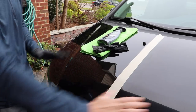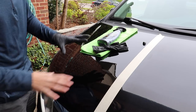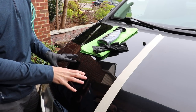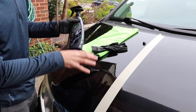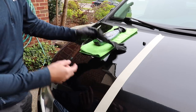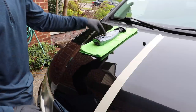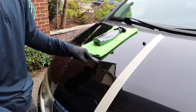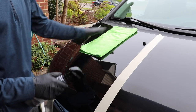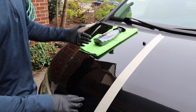Let's look at the black paint we're using it on. Full disclosure — this is a minivan hood. The left side is taped off from the right side, which is about a little more than a third of the hood. This was polished with the ceramic acrylic black polish about a week ago, and then I applied the ceramic acrylic black wax to the polished surface, let it cure for 24 hours, then applied a second coat. So this part of the hood already has two layers cured — the second cured for about 48 hours. I'm applying this to show how it applies, but just know this will be the third coat, giving additional protection and the benefit of the doubt to the product.